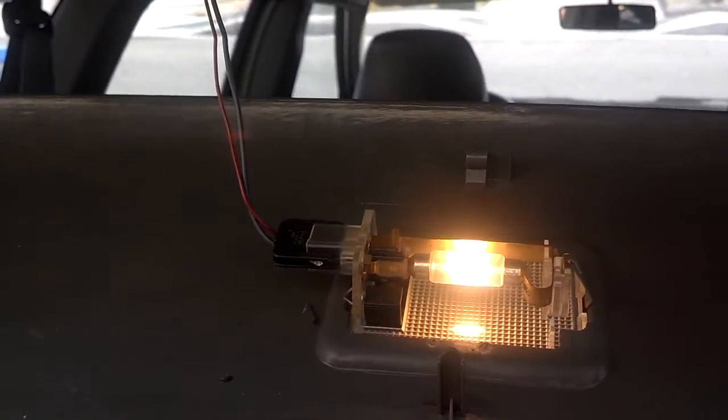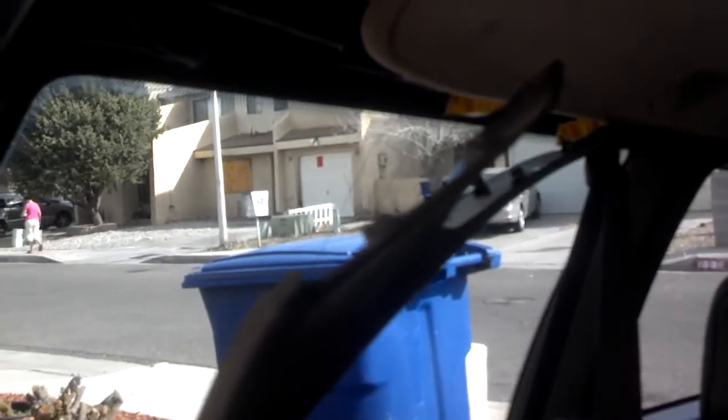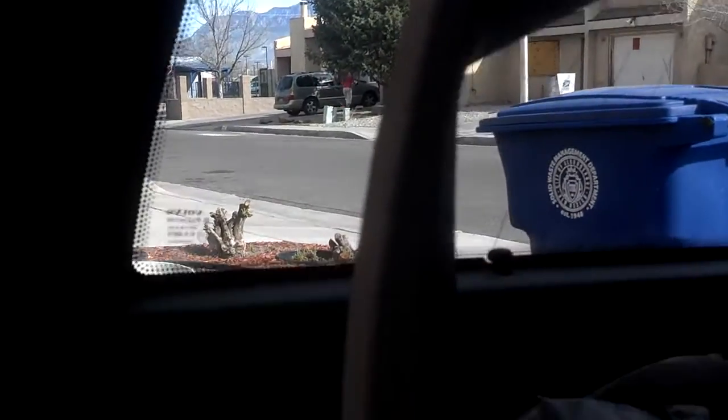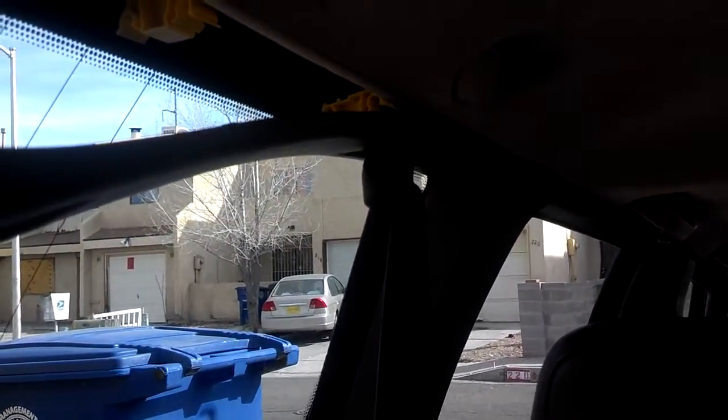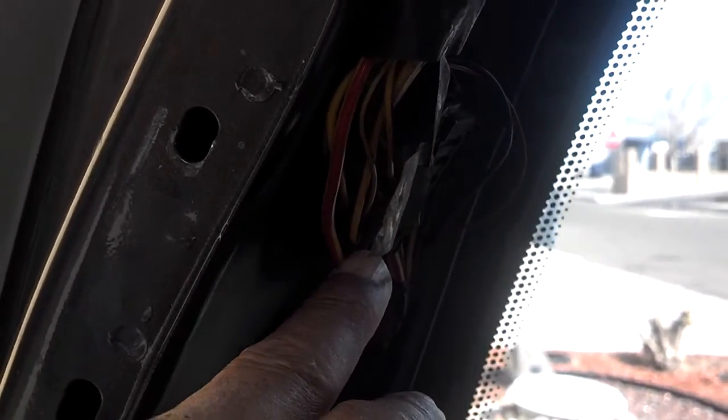Go ahead and unplug the light. Next, you've got to pull that screw out from up there — T25 — and then work this trim off, but be real careful because it's fragile as well. I'm going to let that trim lay with those clips popped loose so that I don't break it. Since this vehicle has a third row seat, it'll be hard to get it all the way off. Here's your main plug for all of the wires going into the hatch. The wires come up from the floor to this plug, and then up through this curve into the tailgate. The suspect is that there are broken wires in this joint somewhere, so we need to test these wires from here to where they end.